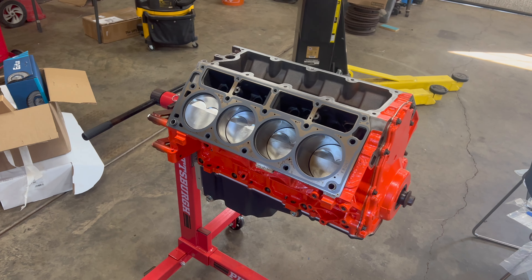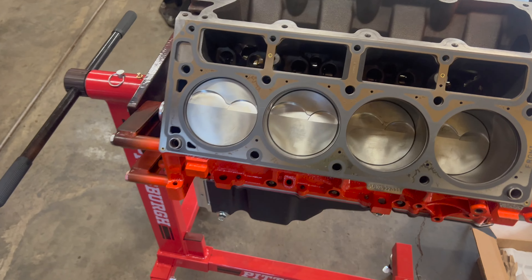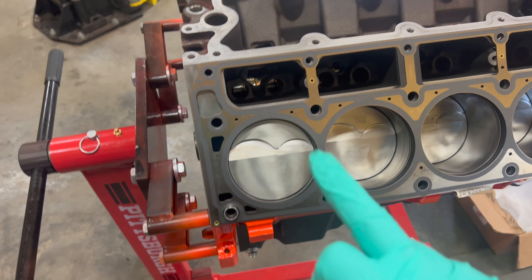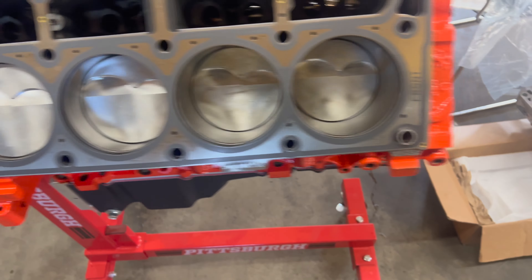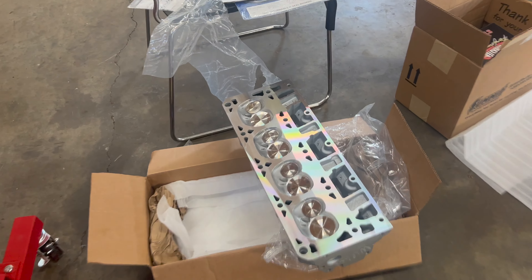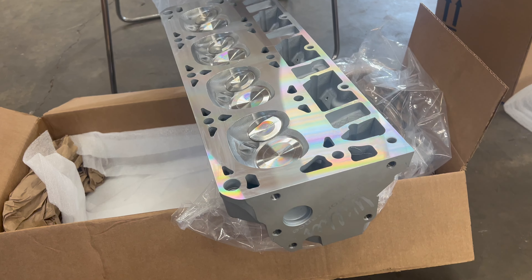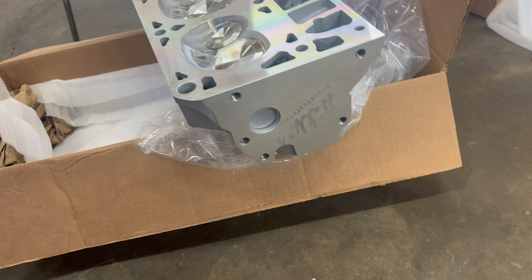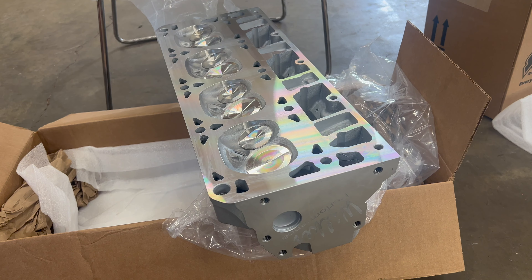So we're back over here at the shop today. Been on a cruise this morning, but we are back. We went ahead and cleaned everything up. We've got our LS9 head gaskets on, new dowels in, and I've got a little surprise here. I had some 243 heads worked, shaved, and fitted with bigger valves with Wilkes Performance down in Alabama. We're getting ready to throw those on.